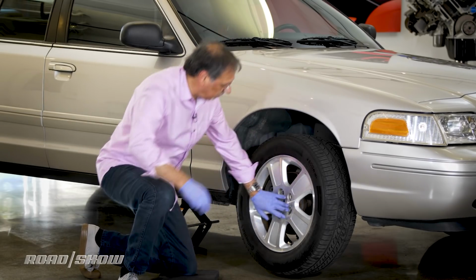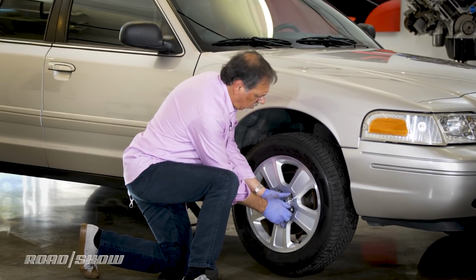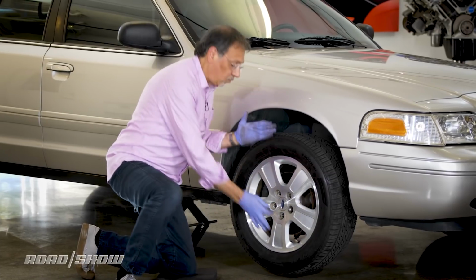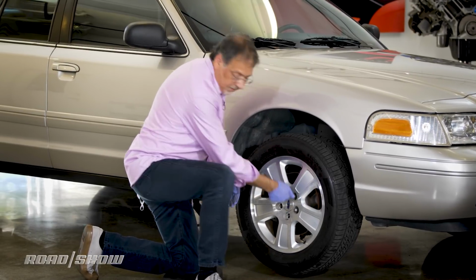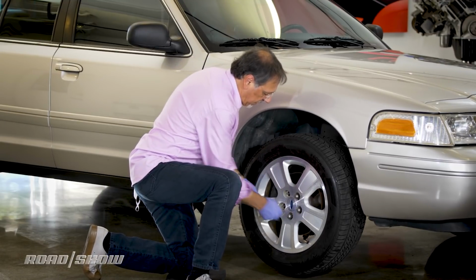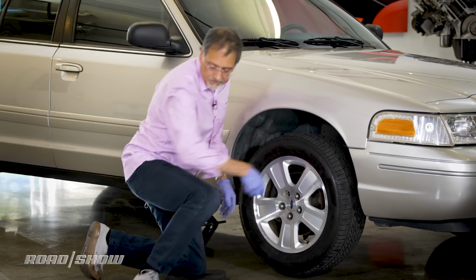With that, we start putting on our lug nuts or potentially bolts. Hold the wheel against the hub like this. The wheel is going to want to do this. It's going to want to be flanged out because of its weight. It's kind of hanging on a hook. Start these guys by hand. It's all you're doing. Just get them so they touch the wheel. Not using any tools.